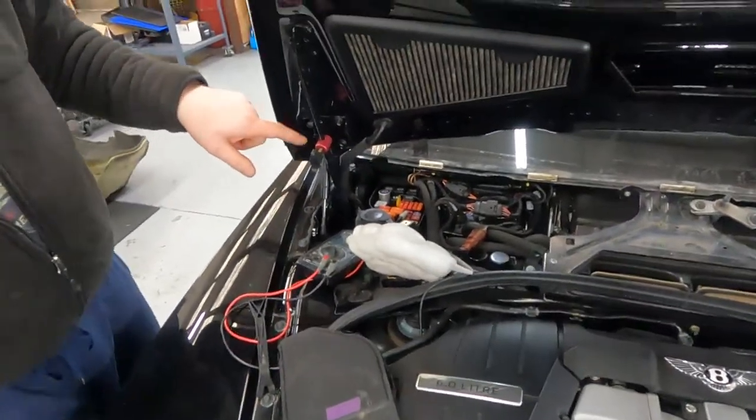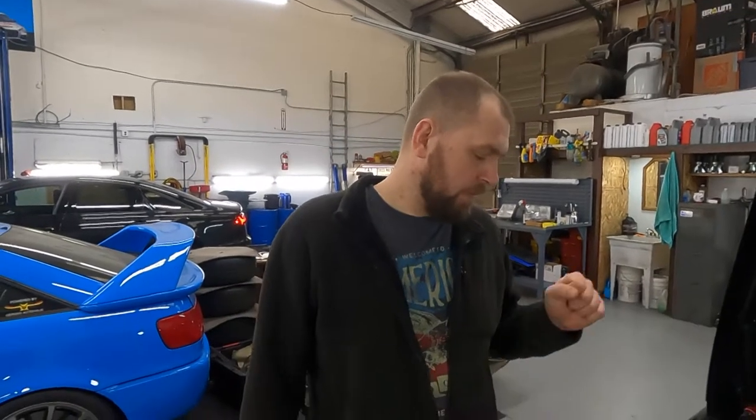inside. And the problem is now we don't have any actuation for the ECU main relay. We have two ECU power supply relays, and one of them doesn't have any actuation. If you mechanically bypass this, yeah, it's fine, it works, the engine runs, but there's no actuation. We need to check a wiring diagram and still check what's going on, what happens.